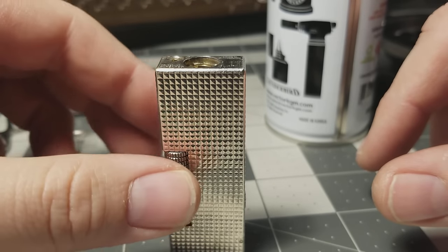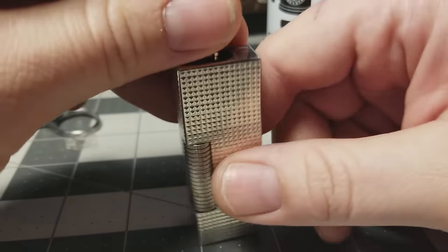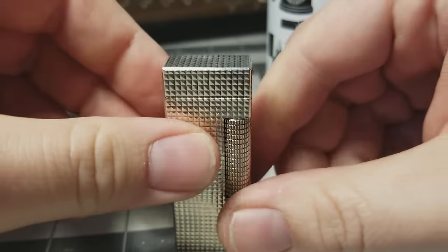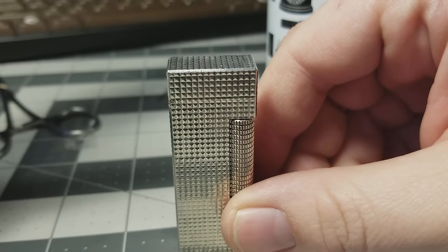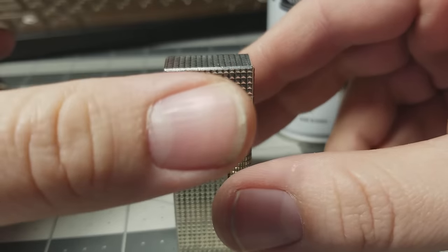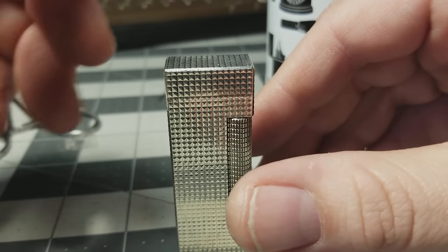Assuming it worked, that's how you refill your lighter. Once filled, put the fill cap back on so you don't lose it, then open the cap. If you hear gas hissing out, that means it's too much gas — don't try to light it yet. You have some adjustments to do first; if you try to light it, it's just going to do a blowtorch impression.